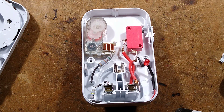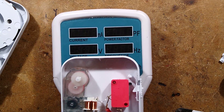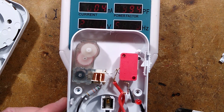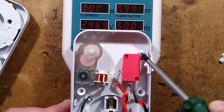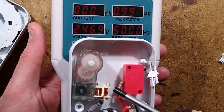I'm going to plug this in and we'll actually measure its power. So let's plug it in here. It is whizzing around at a fair speed in there. The LED is so dim for that dissipation. It's showing a current of 4 milliamps, a power of 1 watt, a power factor of 0.998 — because it is basically acting almost as a purely resistive load.